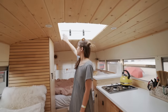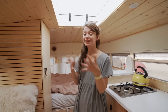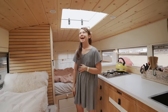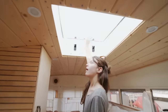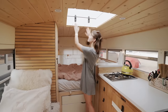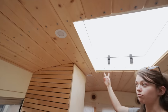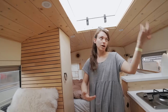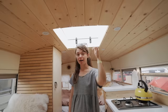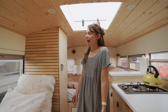I did decide to put in a skylight on my bus. I don't regret it, but I will say they are super, super leaky unless you really know what you're doing. I didn't know what I was doing when I built this, but there are a lot of people that do, so definitely follow people on YouTube who know what they're doing. This skylight does open up — I don't have hinges quite yet or a thing that keeps it open, but it is nice to let in a breeze when it gets really hot in here. My ceiling is tongue and groove pine, attached directly to the bus ribs. I don't think I would do that again because there is some thermal bridging happening — my screws are really, really hot when it's hot outside, because the sun goes straight from the bus roof to the ribs to the screws. It's definitely hot in here because of that, but it works.